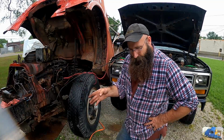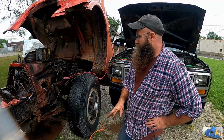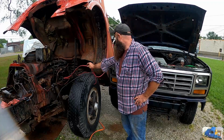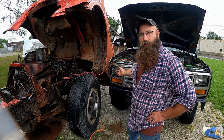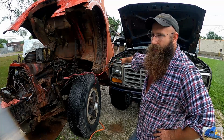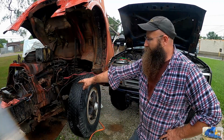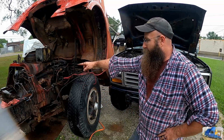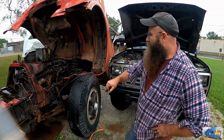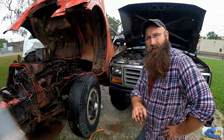And here, I said it before, but I'm saying it this time 100% sure. This is the last attempt. We're getting really crazy with it. I have solid battery cables straight to the old flatbed Thunder truck here. That's actually the main battery. It's tied in directly to the main battery, goes to the starter solenoid, and then the ground goes directly to the starter. That ground wire on the starter, the cable that latches it to the frame, is a little questionable, so hopefully this wire straight from the main battery source to the starter is going to give us the full shot. This is going to give us all the juice.